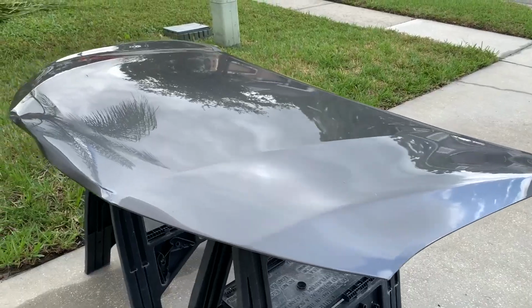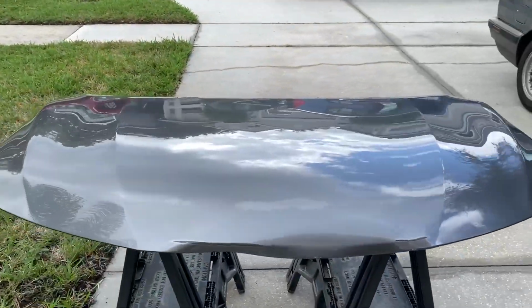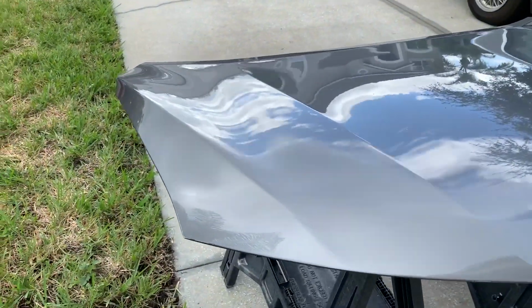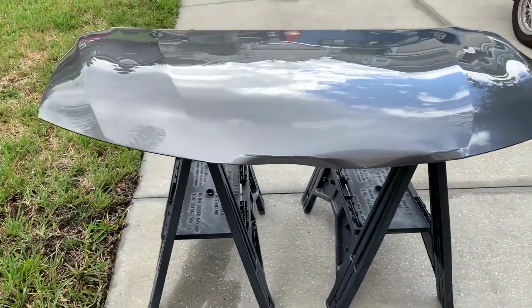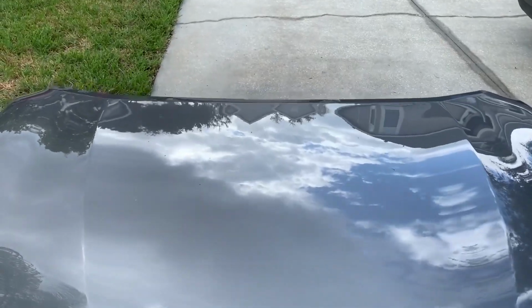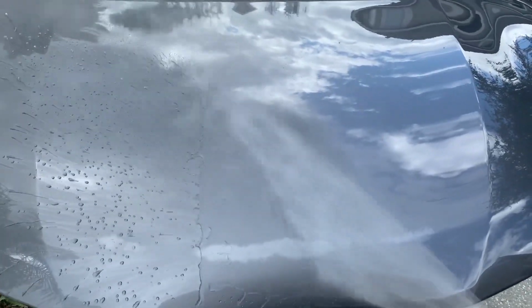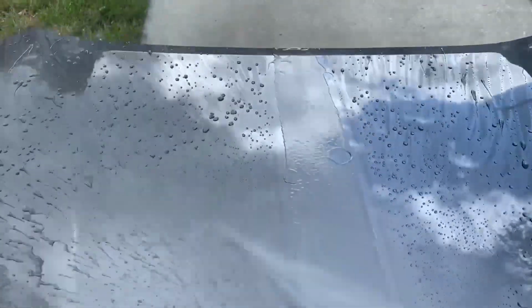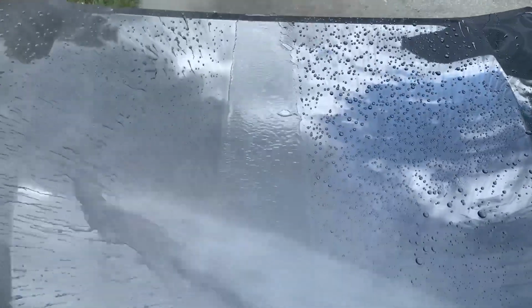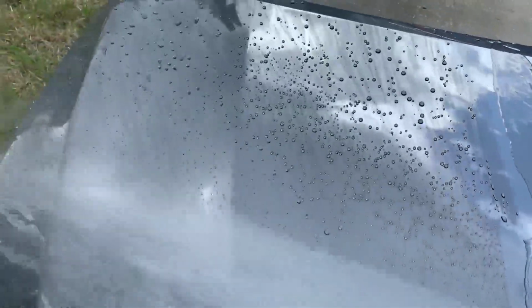And the coatings were applied 2 weeks ago onto the paint. I waited 1 hour before applying the second coat of each coating on top of the first coat. And the paint was prepped using 3D1 hybrid compound and finishing polish. I followed that up using Sonax Perfect Finish on a yellow Rupes polishing pad. And then I used Ethos Detox. That's their recommended paint cleaner to help clean up any of the polishing oils that might have been left behind from the polishing process.